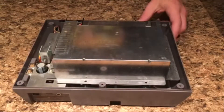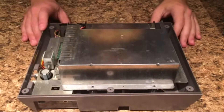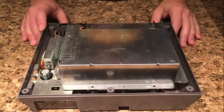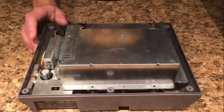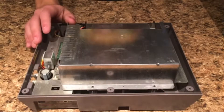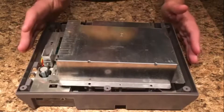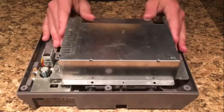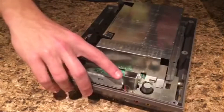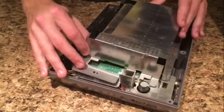All right, I've taken all the screws out. One thing I want to mention: all the screws we've taken out so far — all 13 of them — were exactly the same, so you don't need to worry about isolating them. However, in the next step and at the very end, we'll get into screws that are different and you will have to isolate those. So now take this RF shielding out — RF shielding is just the piece of metal that protects the motherboard. You may hit some resistance because this little piece is stuck under there, so you'll have to pull it out this way and then lift it up.